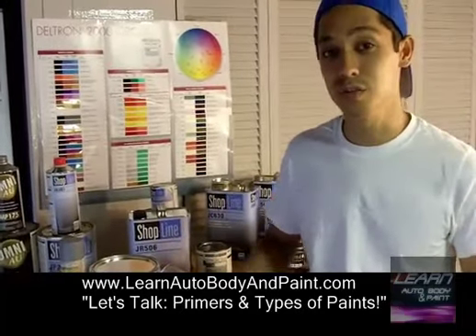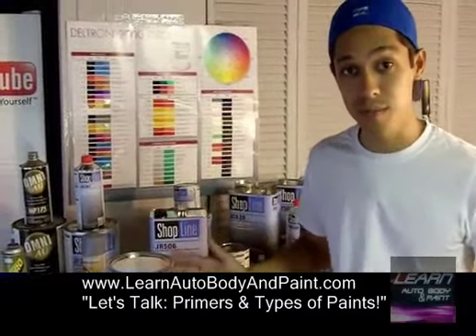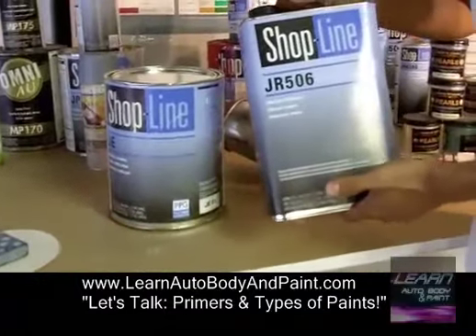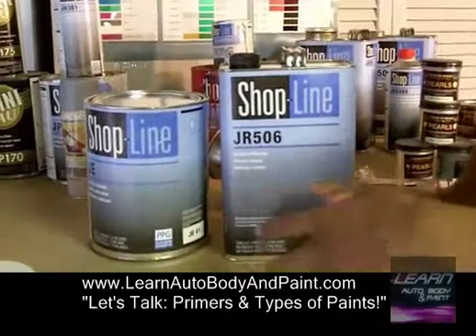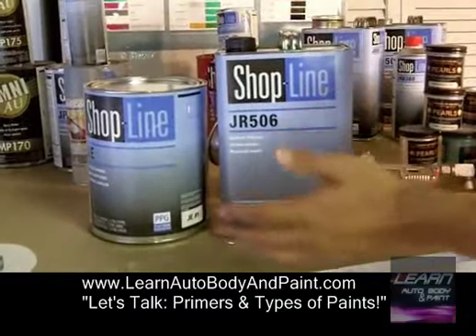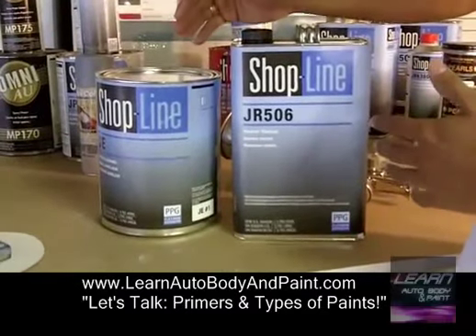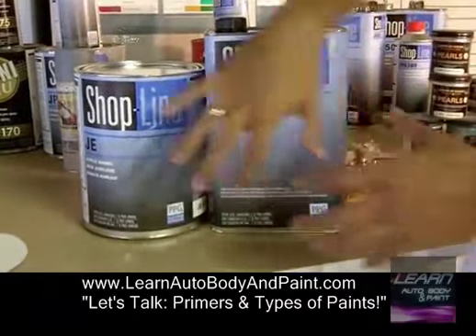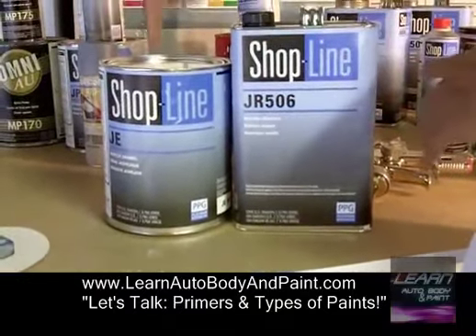You just have to pay an extra $40 for the catalyst hardener. The mixture we're going to use with this system is the same reducer — this reducer is used for basically everything. Same reducer we're going to use for primers, base coats, and clear coats. We're going to be mixing it for our enamel single stage system. This is a 4-to-1 mixture also — four parts paint to one part reducer. This setup right here is about $110 for everything. You can paint a complete full-size car with this, no problem, and have a nice gloss.